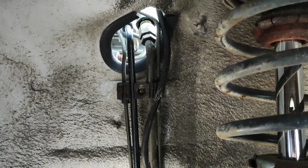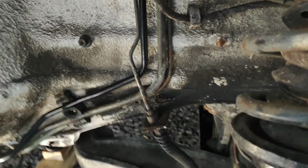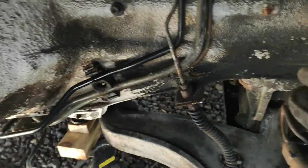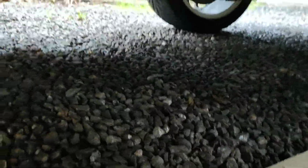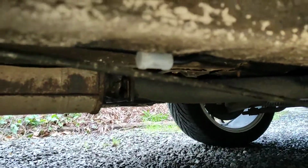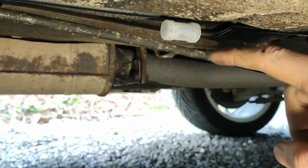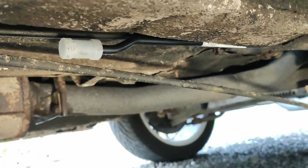Okay, so off camera we've put the new pipe into position so we could wiggle it around behind this brake pipe, because it's only a short length now. Put it into its proper mounting holes, and I've checked it's in the right place up there. So underneath we've got the existing pipe here hanging down, and the new pipe running in the channel where it should be.